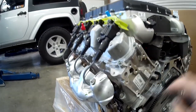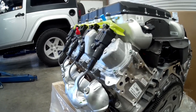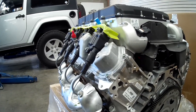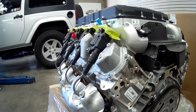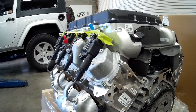These engines run what's called coil-on-plug. Back in the 1990s we were trying to get rid of distributors — Ford did the dual-plug coil, for example. Actually, having a single coil per cylinder has advantages. Not only can the computer control each cylinder individually, but there's less chance of failure. Coil-on-plug has pretty much become the standard for these engines, and it's a really reliable, excellent setup.